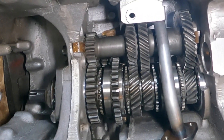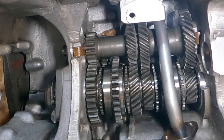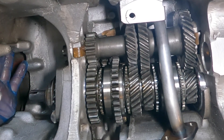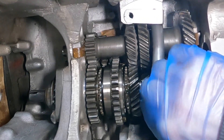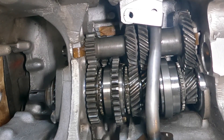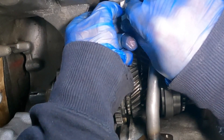And that's going to be it for today I think. On the next episode, I'll more than likely be fitting the speedo drive housing. There's a little bearing to go on the end of the nose of the input gear, and basically doing up — putting the gasket on the central oil pickup and doing that up. What I will do now though for now is just put the nut and bolt in, just so I don't lose it, just put it in finger tight, just loosely.